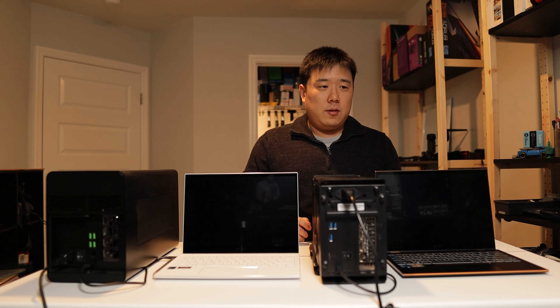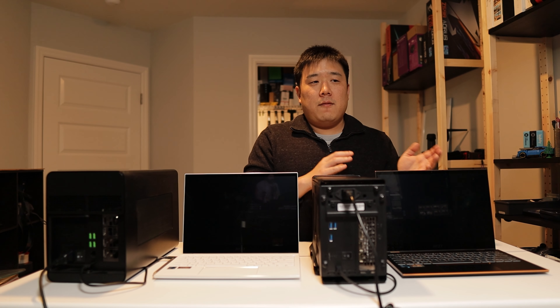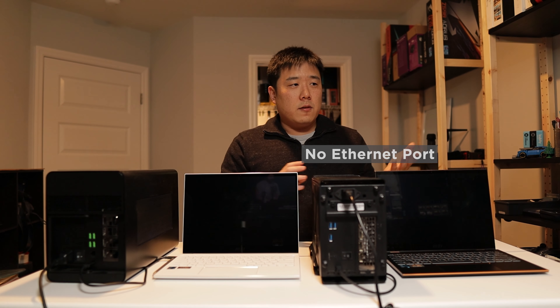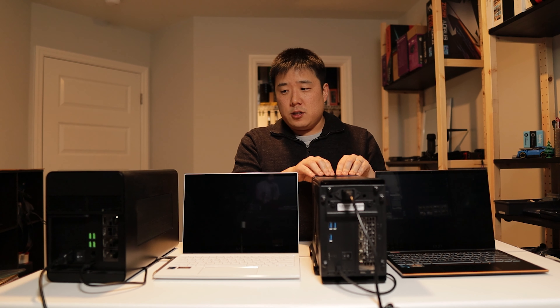Yes, I do want to enjoy the maximum bandwidth of the cable. However, you're using an eGPU mostly for convenience, so I'd rather have that option or at least be able to use a couple of USB ports so I can connect keyboards, mouse, headphones, and such. And for ethernet on this unit, it is not offered. Therefore, you're going to need some sort of converter from regular USB Type-A to ethernet. At that point you end up with a lot of different cables and connections to your laptop, so that is sort of the downside of this specific eGPU.